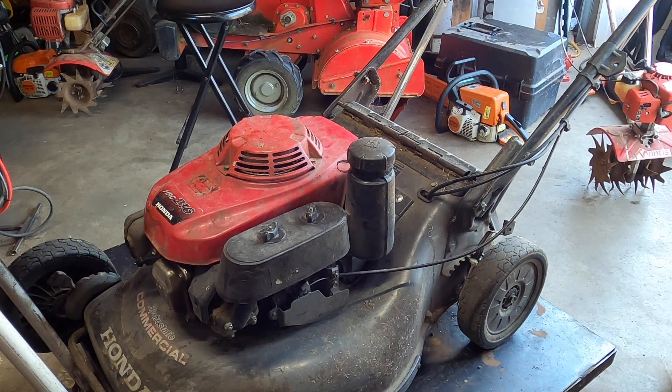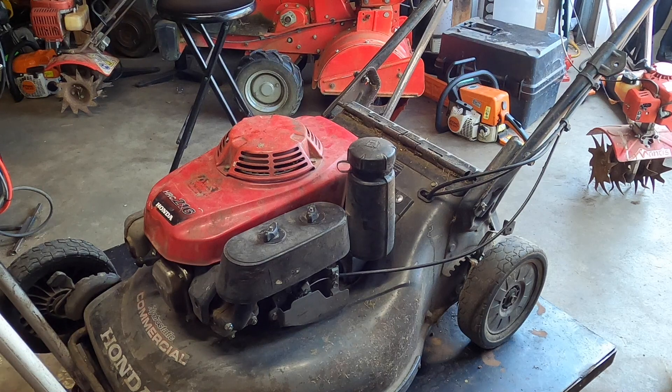Technically you could just buy a whole new cover, though you'd probably have to buy the little decal separately if you even care about it — I personally wouldn't. Or you could just do what we did here today — not that hard, limited welding needed. If your cover shakes like this and you have one of these metal covers, take a look at the holes inside — either replace it or build it up with a washer like I did. The welds could eventually break, but I've done this two or three times and never had one come back. Hope you like what you see — keep watching, subscribe, follow me on Instagram at smallengine101. See you in the next video.